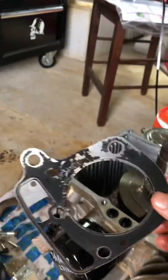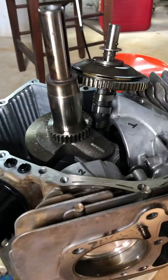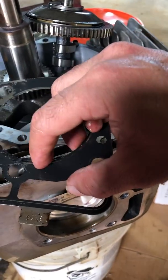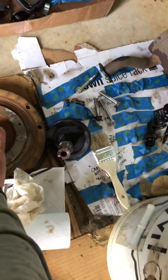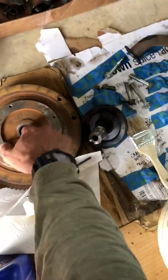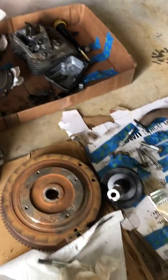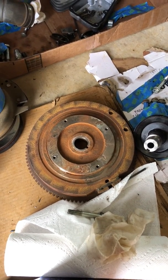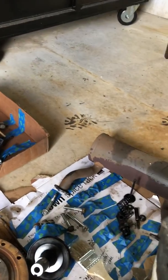This is an example of the head gasket. When I took it apart, all the head gaskets seemed in pretty good shape. I think the leak I had on this head gasket was probably just a loose bolt causing the oil to spill out — it wasn't a failure. A failure would be like a line going through it. This is the flywheel right here — a very heavy piece of metal, and underneath is the stator coil spinning around generating electricity. Maybe later I can show you the timing of the spark plug in the flywheel, but that'll be for another video. Over there I've got the carb, the other head, another valve cover, and all the bolts and pieces that go to this engine. Thanks for watching.